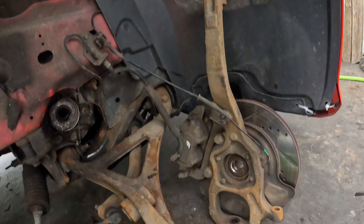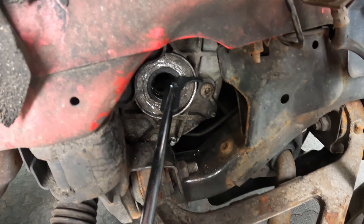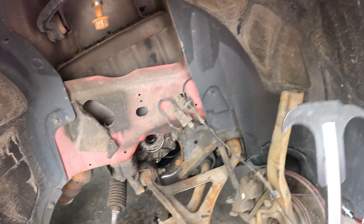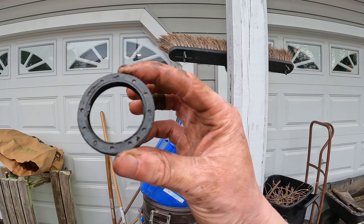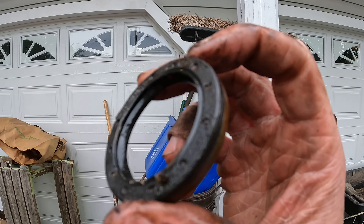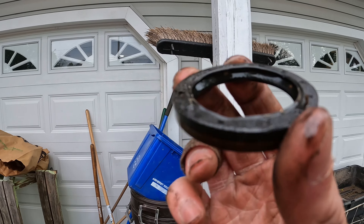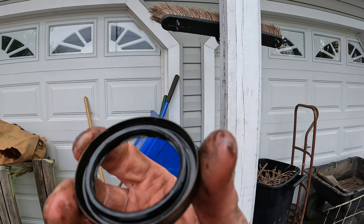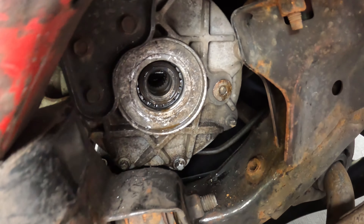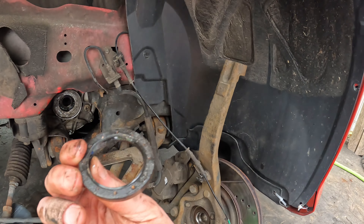I'll catch up with you guys after the seal is out. Here's the seal — it looks very old. Sorry about my greasy hands. That's all the diff fluid — it looks kind of smashed in. That definitely could be the reason why everything's leaking. You guys can see the fluid got all over — definitely worth replacing this for sure. I know this is a lot of work for one thing, but if it keeps your front differential sealed, that's all that matters.